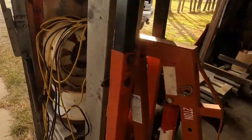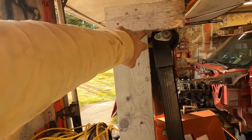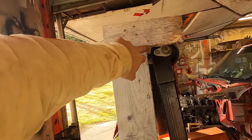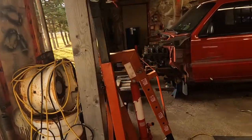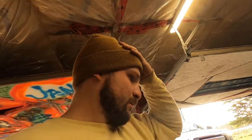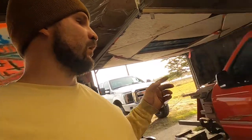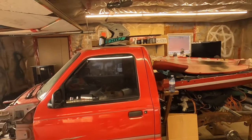It's a bit of a mess in there. I'm getting ready to pick this up. I actually have a jig built and I've pulled multiple cabs with it. It kind of sits on the outer door frame once the windows are open, and I use the engine crane to pick the whole cab up. All four cab mounts are unbolted, and I support the transmission — right now it's supported by a ratchet strap — but I'm gonna put some spacers in the crossmember and get that sorted. It'll be enough room to change the bushings and those cab frame mounts.